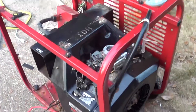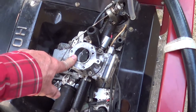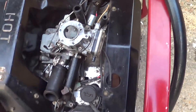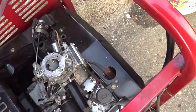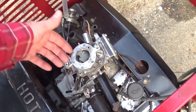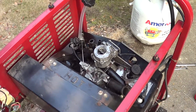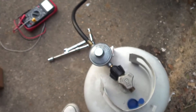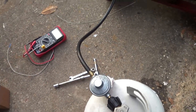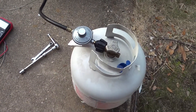The next thing to do will be to put an actual venturi on here and a demand regulator, so this can regulate without me moving the knob. What that does is it applies low pressure to a regulator and then you have a venturi that pulls out the gas that it needs. This current regulator is for propane — it's got about 14 inches of water column, which is a little bit high for my demand regulator, so I need to get a different regulator on there.